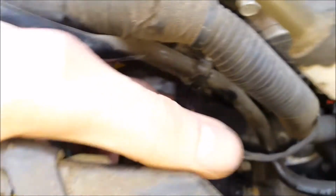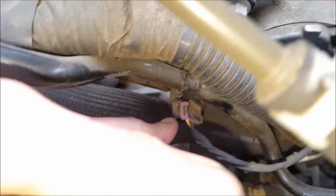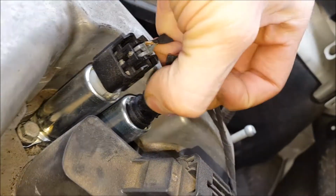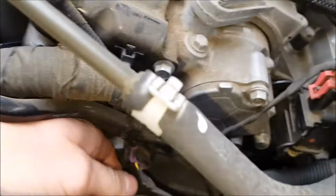So to begin, I'm going to disconnect it. There should be an orange plastic tab that is part of the connector, and you have to slide that backwards. It's similar to what you see here, where you pop that up and then you're able to disconnect it. But it's already missing on this. So I'm just gonna grab that, disconnect it there, move the connector out of the way.